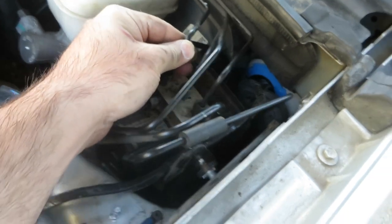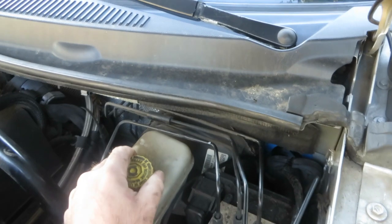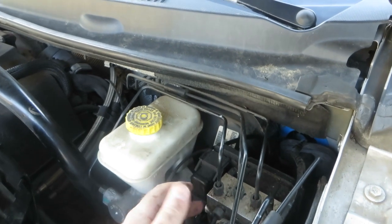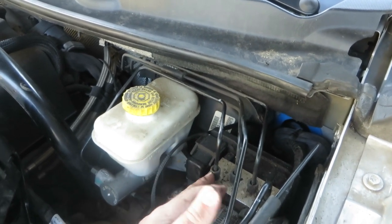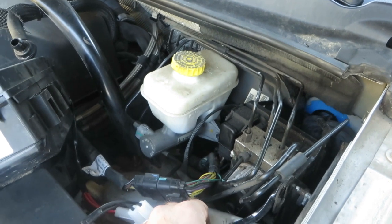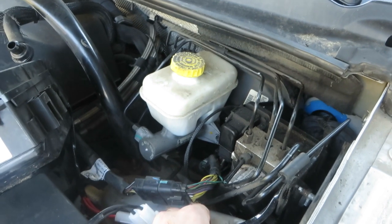You'd have to be some kind of magician to get the brake booster out of there, because the brake booster is about six inches deep. It looks like I'm going to have to take off at least four of the brake lines to get the ABS and the master out together. I'll probably tackle that tomorrow because I have to drain the system - I don't have power right now to use my vacuum pump.